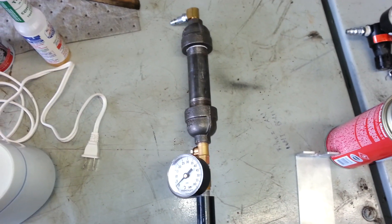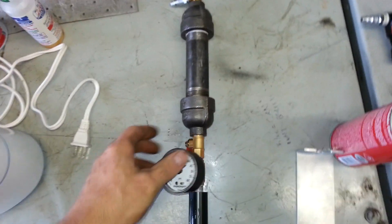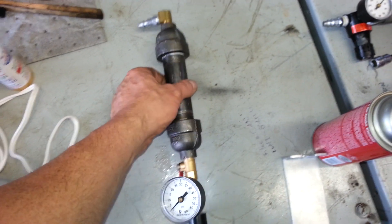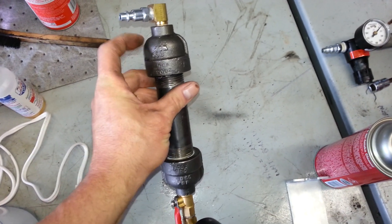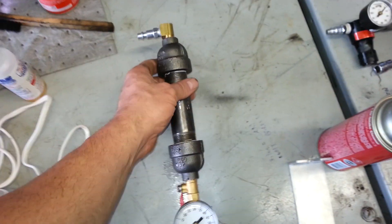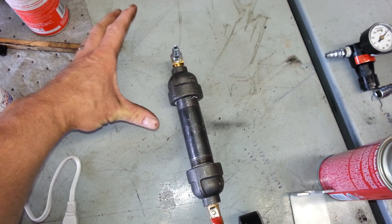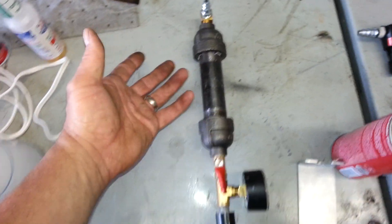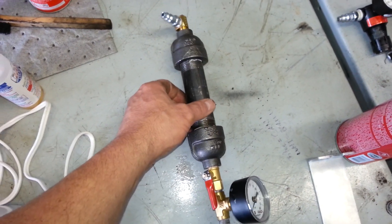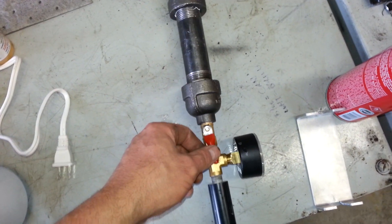What I did was make my own fuel injector tester cleaner. There are some different ones out there, but this one's very simple. Some guys I know have been drilling and tapping the caps, but I think it's easier just to get a bell reducer — saves all that work. There's really no need to go with a big pipe or tube; it's not like you're filling it really high. Here's just one I made to give people ideas on a simpler one to make — some pipe fitting, a little ball valve.